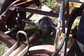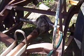And all I have to do is re-drill the ends of the Morris Minor axles, which I'll probably have to have done because it's hardened, and slightly shorten the drive shafts. But the spline's long enough that I can get away with the 20mm that I have to take off each side.